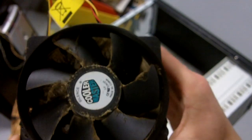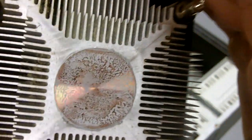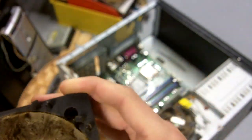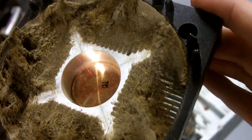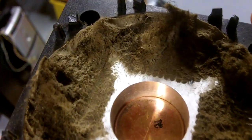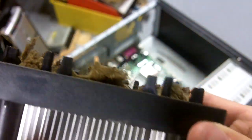Let me grab the CPU cooler out of there and show it to you. The camera might not capture the full extent of the damage, but basically the overheating problems my relative was talking about aren't helped by the fact that there's virtually no thermal paste on there. You can see some of the buildup of tar and pet hair in there — a huge buildup. This fan is removable, so I'm going to remove it to show you guys. And there she is. The cause of all the heating problems. I'm surprised the CPU even functioned. This is literally solid blocks of pet hair and tar. I've seen pictures of stuff like this but holy moly.